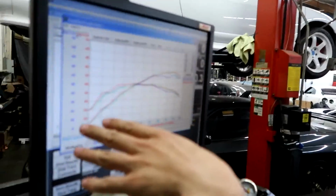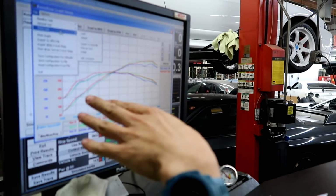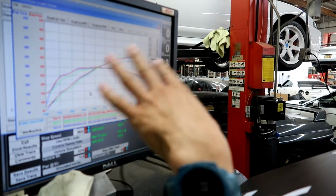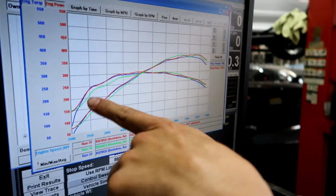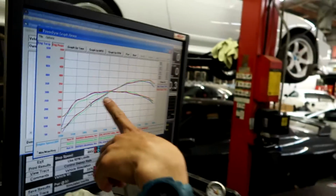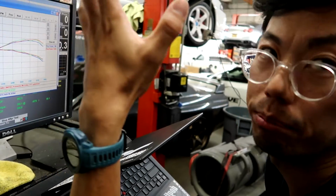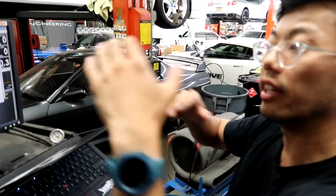And then I compared that, so we're going to change the blue one now. I compared that to locking it at 50 degrees. You can see locking it at 50 degrees actually brought the top end up even more, and that's a lot. Most people would be like, oh man, you're bringing the intake cam all the way to 50? OEM does do that, and that's the maximum limit, so I never want to bring it all the way to 50. So I find an area in between.